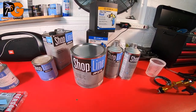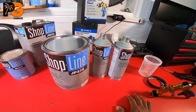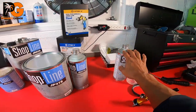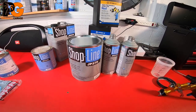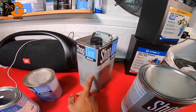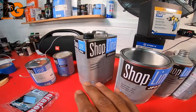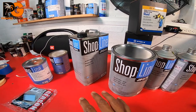This is a 2:1 mixture, so if you're going to use a half gallon of epoxy primer you're going to use one quart of hardener, and you'll have a half gallon left over for another quart. After you mix it you can also reduce it — that's another option — 5% to 10% depending on the flow, to spray out of smaller tip sizes.